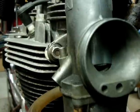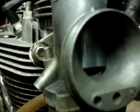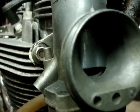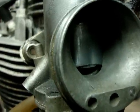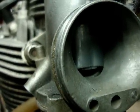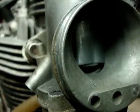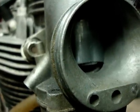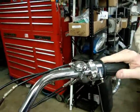Now when we move this to where it's parallel with the bar, just like this, that actually closes the choke for cold starting. Now if we move back down to the carburetor, you can see that the choke valve is closed at the bottom. I just opened the slide a little so you can see it. Now as I open this back up, it lifts that up out of the way, and that opens the slide to allow more air in after the engine is warmed up. So cold, we close the choke valve, that obstructs the air, and that richens the mixture and allows the engine to run cold until it warms up.